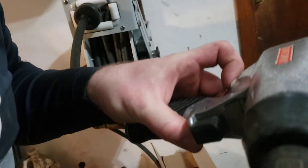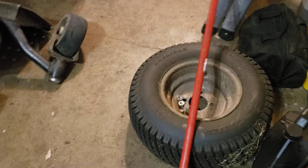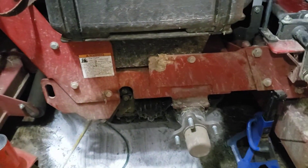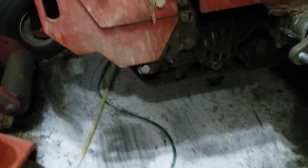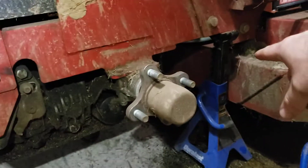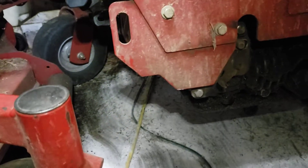The first thing you're gonna need is a 13/16 socket because you're gonna have to remove the tire. Use your impact - four bolts. You can see why I got all that stuff on the ground; this thing leaks. I've got it jacked up and I have one jack stand under it, and another one for when I start leaning it - that one goes right back here.